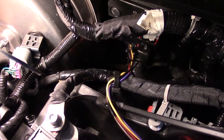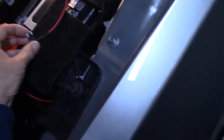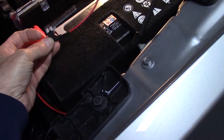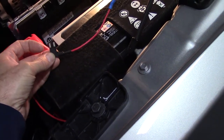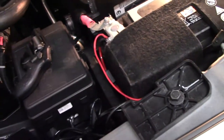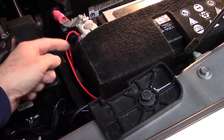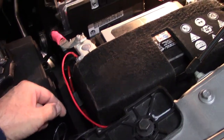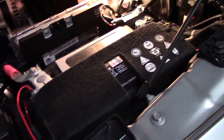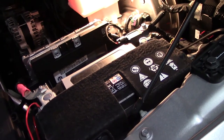So that's how it looks on this side. Normally I use this kind of device — an add-a-line to the fuse box — but on the Rams the fuses are smaller and you can't do it. So I ended up just coming straight off the battery over here. There's a screw on the outside, so I just put a wire, positive and negative, same way on the other side of the battery. That's how I ran the power for the dash cam and for my light bar in the front.